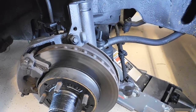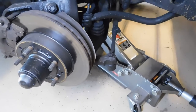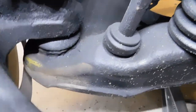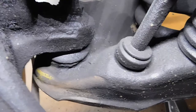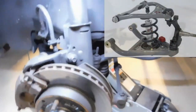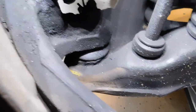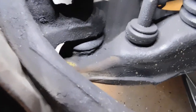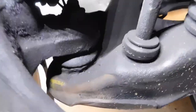Now I'm going to try and get you a shot of the ball joints on the back side of the steering knuckle. Starting from out here — this is your A-arm, because it's shaped like an A. Down at the end of it, where your steering knuckle connects to the A-arm, that is your lower ball joint. On a double A-arm setup, you will have an upper A-arm up here along with the one on the bottom, giving you an upper and lower ball joint. But in this one we just have a lower ball joint. When you do that test with the pry bar underneath the wheel, this is what you're looking at — set your camera up to see if there's excessive play in that ball joint. If so, it will need to be replaced.